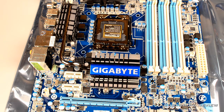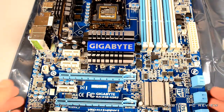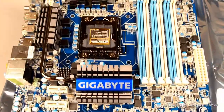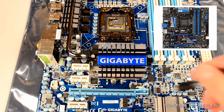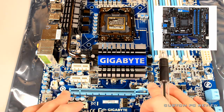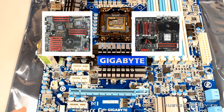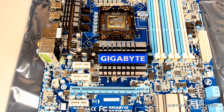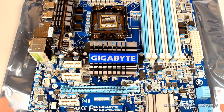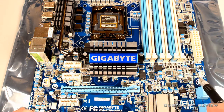The first thing you have to look for is the form factor. As you can see from this motherboard right here, it is a full-size ATX motherboard. They also sell a smaller form factor, the micro ATX, which is usually just enough for one PCIe x16 slot. There are also extended ATX and HPTX, which are for people who intend to run three or four-way SLI. I do typically recommend people buy a standard-sized ATX motherboard.